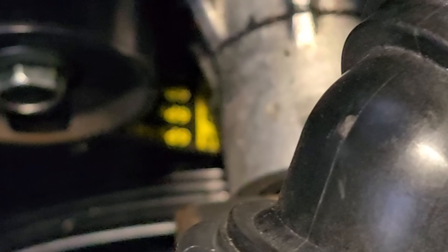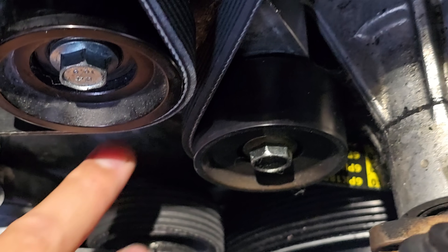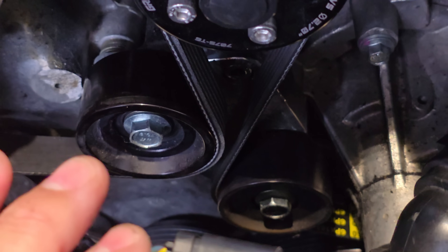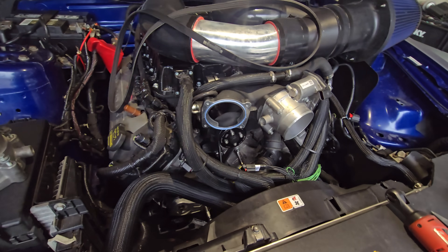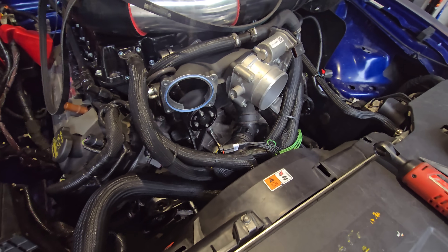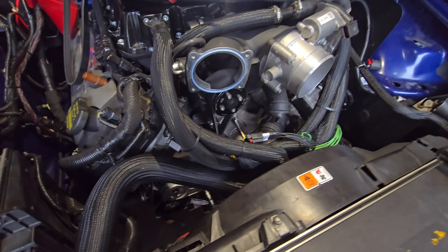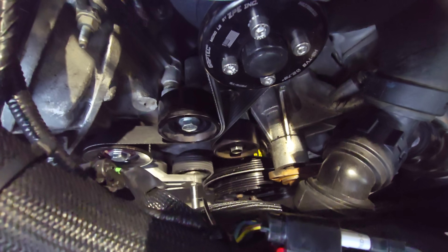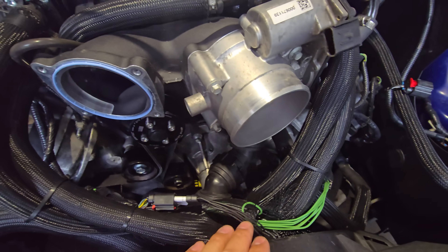I ordered and installed a six-rib 73-inch Goodyear belt from Amazon, and I have a much better tension situation. After putting it in, I could probably get away with an even shorter belt — like 72.5 inches — but this is pretty good. I'll probably order a 72.5 as well, keep this one as a spare, reassemble everything, and see if this routing works. It's routed pretty much like a GT500 would be routed, so once the engine turns over everything should straighten out nicely.